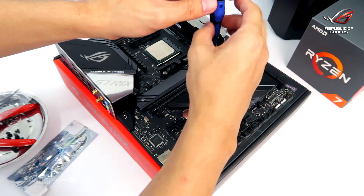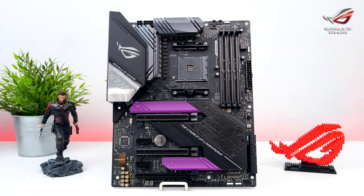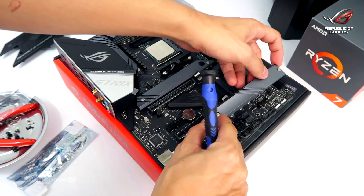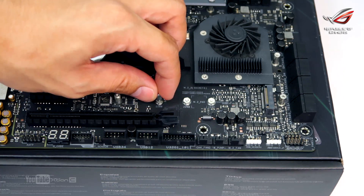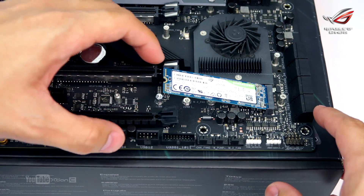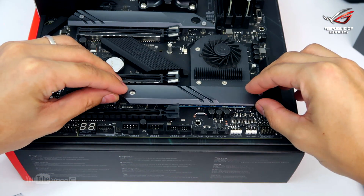You might need a little bit of force but don't overdo it. Next, we're going to install the M.2 SSD. Before we have access to the M.2 slot, we need to remove the chipset cover first. The X570-E Gaming has two M.2 slots — you can use both, but for now we will be using the one at the bottom. Make sure the M.2 screws and standoffs are within reach. Remove the heatsink and place the SSD. We'll be using the Seagate Barracuda 510 SSD 256GB. Screw in the standoff to the M.2 and angle the SSD into place. Once done, peel off the thermal pad from the heatsink, place it back, and screw it in.